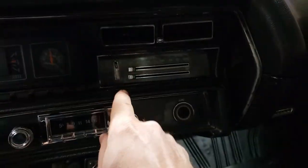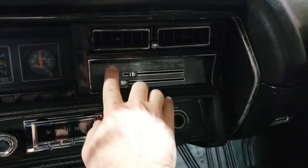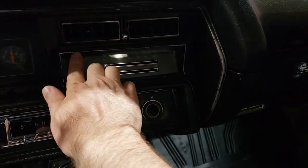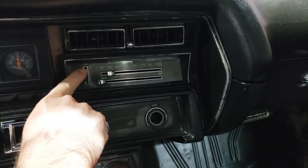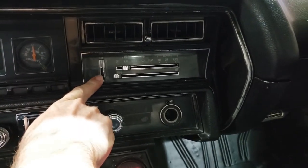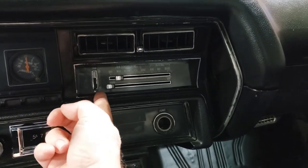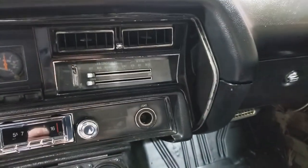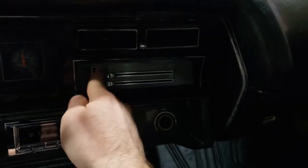Thankfully for me this was really easy to figure out. So, air conditioning on. Now, since I replaced the motor it's nice and quiet — probably hard to hear. But you might hear it spinning up and then nothing. If I push on the switch on the side, you can hear it kicking on that relay and the fan comes on.